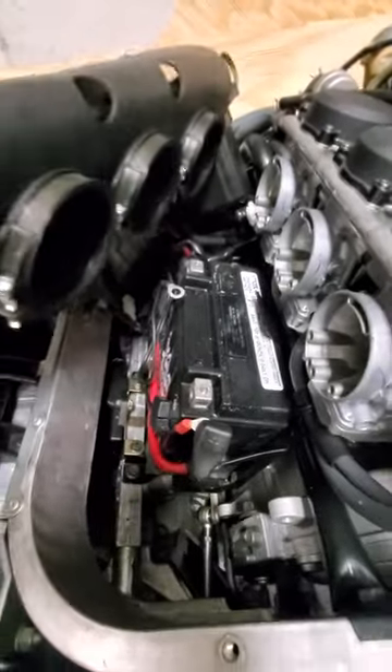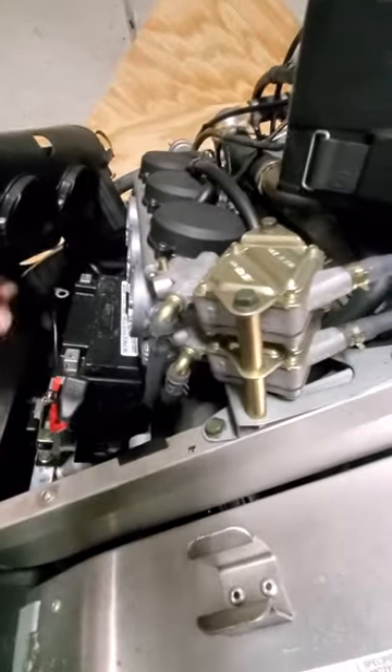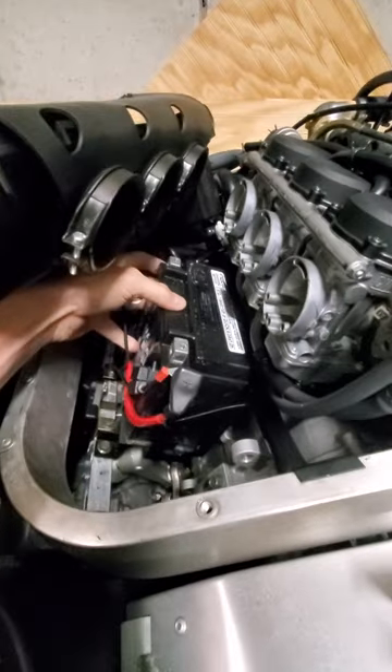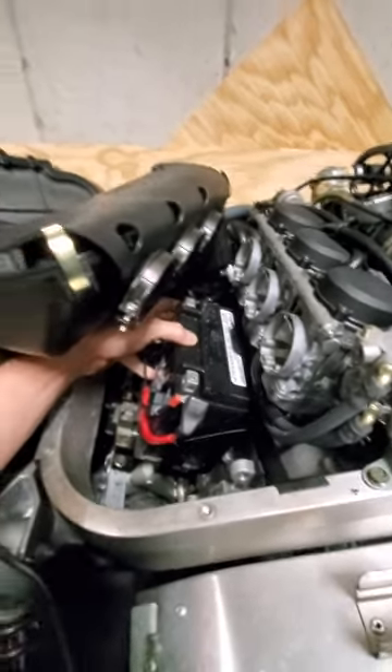Then there's a cover on the battery there. Mine was kind of stuck on there, so I had to wedge in to the side — I had to wedge in over here to get this thing off. This just has two little snaps. Go around the battery, pop these off. Now I got my battery out, and I can go get it tested and replaced because it pretty much definitely is dead.